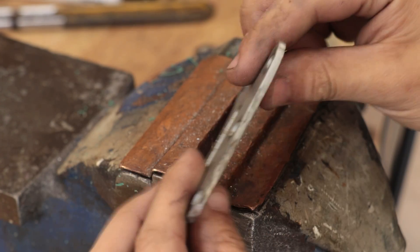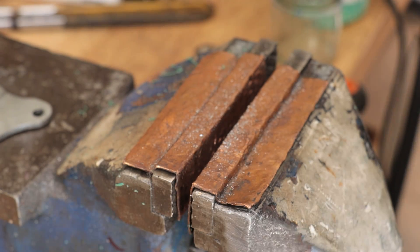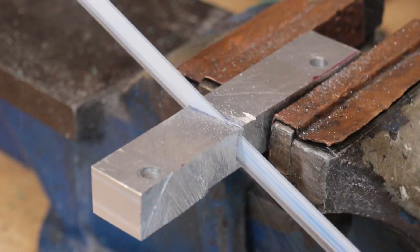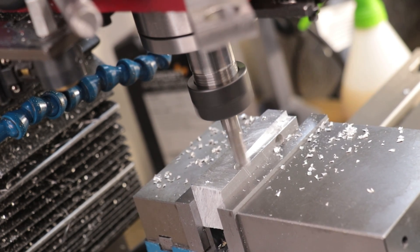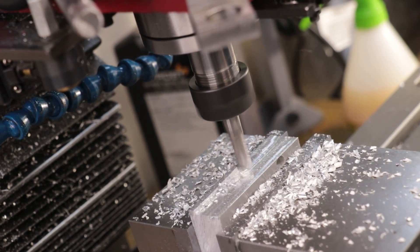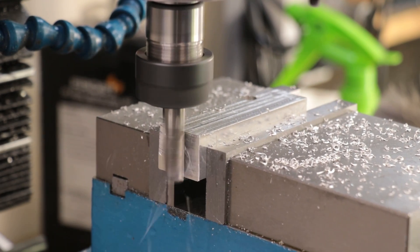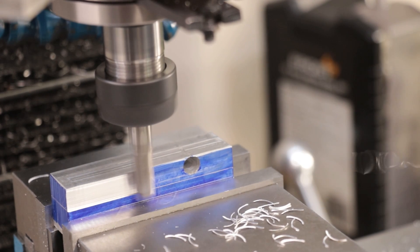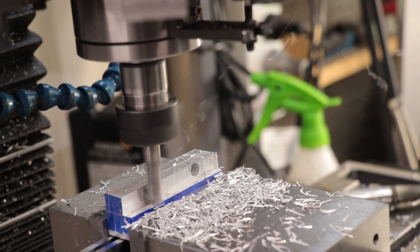Unfortunately I only noticed this the night before I was supposed to race, which meant I didn't have enough time to order a replacement or buy a piece of nylon. I don't really work with nylon in the workshop so I don't have any big pieces on hand. Instead, I decided to make a replacement using a piece of aluminium. I don't know if aluminium is the right material — I know stainless steel skid plates exist — but aluminium should hopefully protect the kart while being soft enough that if I clip a curb it will break or wear away, rather than doing damage to the bracket or the frame.